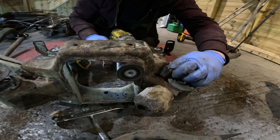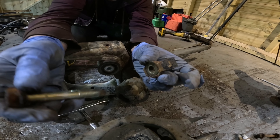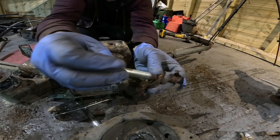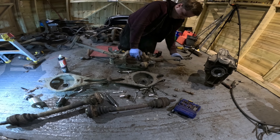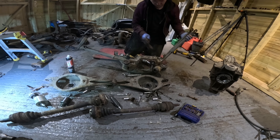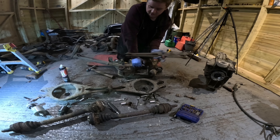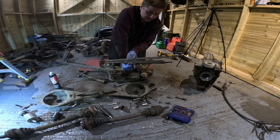The second spring perch - not too bad that side but lots of corrosion inside, so you need a good poke around before reusing it. The arm itself is pretty good. You'll notice they all seem to have these bend marks at the top - probably from coilovers hitting the chassis at some point. Then last but not least you're left with your camber arm. There's a captive anchor point - basically a nut with a lip that locks into the chassis. You don't want that to fall in and be tricky to get out.